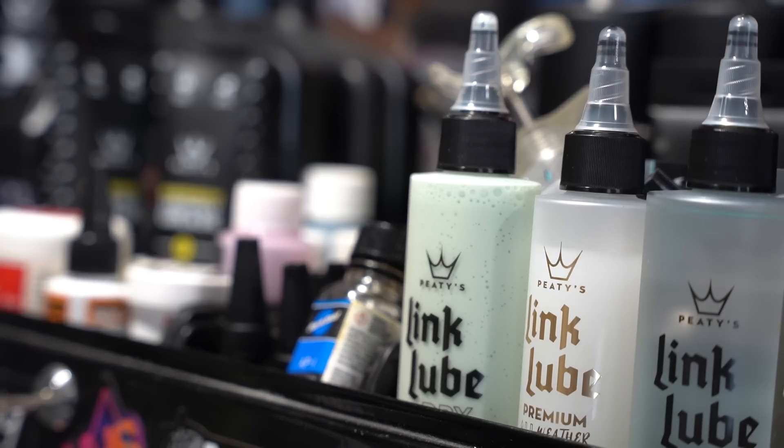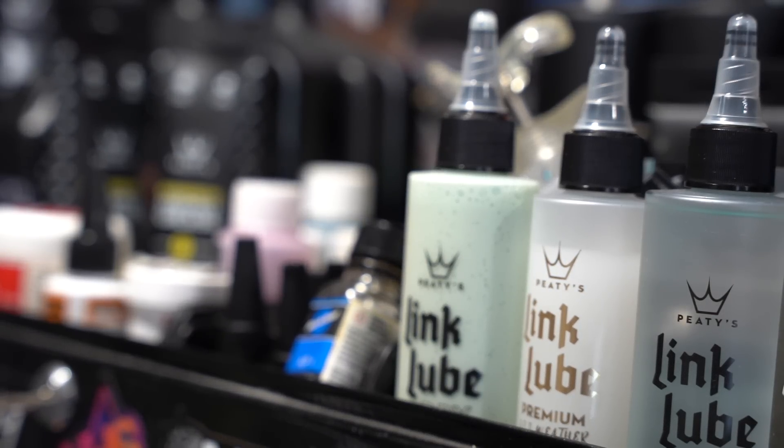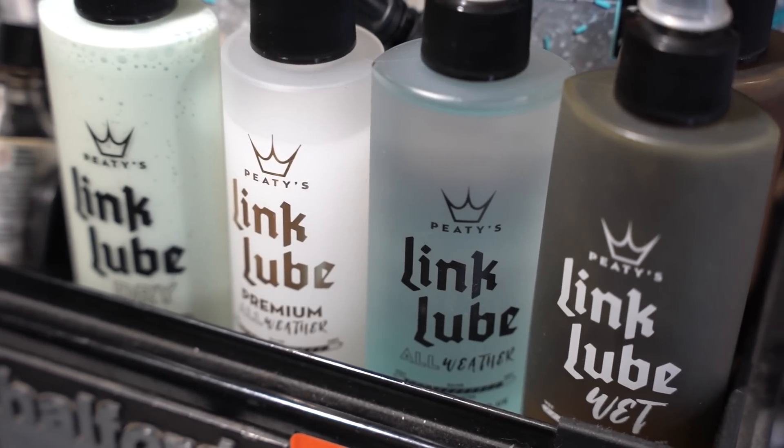Before you ride, you might want to give the bike a bit of a wipe down and put some fresh lube on it. But really, bikes are pretty good. If you've got any steel parts on there, they're likely to get surface corrosion. A good contender is your stem bolt, the top cap one — so a bit of lube in there as well. Put a blanket over it is an idea — a waterproof cover; you can get them cheap on Amazon and places like that.